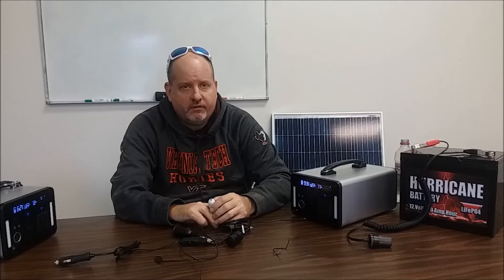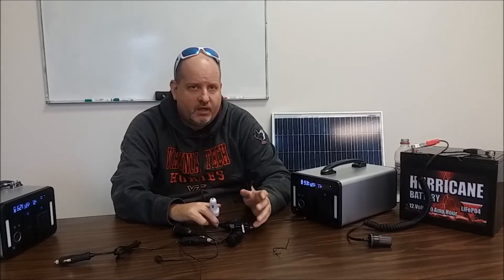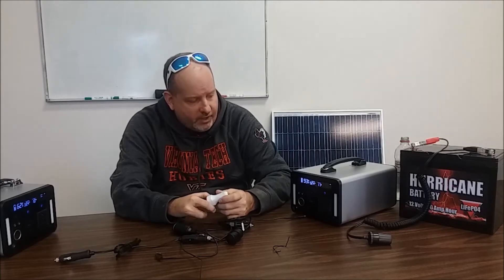The lithium batteries, as many of you probably know, are much lighter as well. With a sealed AGM battery, if you take it past 50% depth of discharge, you're going to kill the battery pretty quickly. We see that with a few of the big box store brands — people call wanting to replace their batteries because they run them until dead tailgating, and they don't last very long.